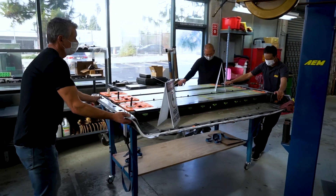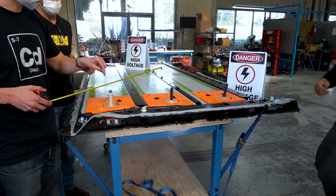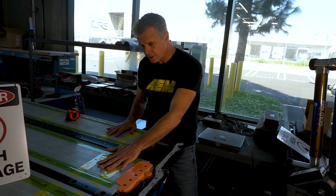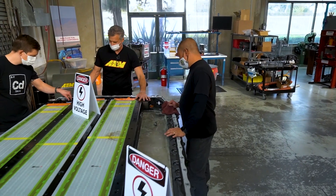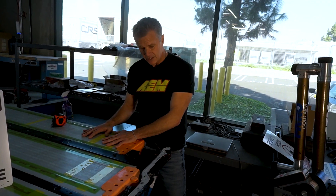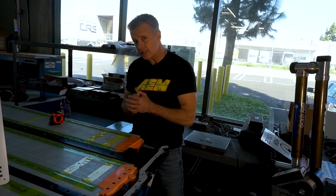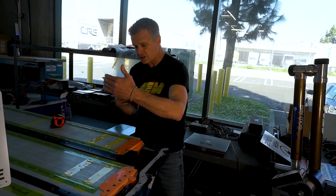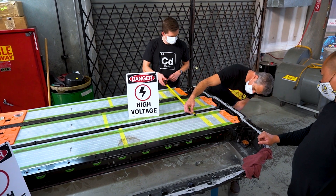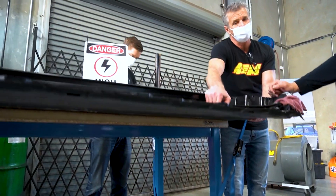This is a 75 kilowatt hour battery pack. With a battery pack of this size, it's like a big fuel tank, so we're going to have really nice range just on the batteries. What's also great is the work Tesla has done for thermal management and the structural integrity of the pan itself — this is actually part of the chassis. The thermal management is amazing, so why would we disrupt that? We're not going to. Two packs wide will fit in the floor pan, and then we're going to take the other two, bring them up on top, and stack them. We get to capitalize on everything Tesla has engineered into that.